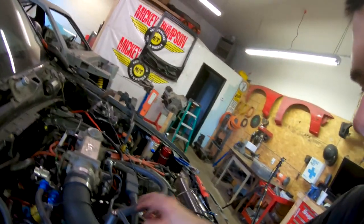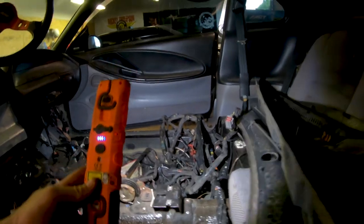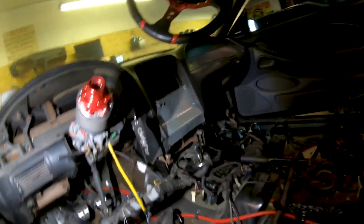The next step is to get everything put together correctly and get it drivable - meaning brake lines and other stuff like that - so I can drive it around, test it out, and see if she works under load. This thing sounds sick. I need to get it mounted somewhere. Obviously some of this stuff won't be there because that's just for testing purposes. All that over there is the harness for the 5.0. All this stuff needs to get taken out, put in its proper place, get this thing actually tied down as it's loose right now. All the fuel lines have to get put in their correct spots with grommets and all that other stuff, just to be safe and pass tech.